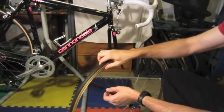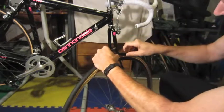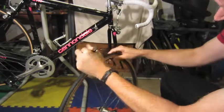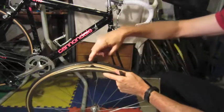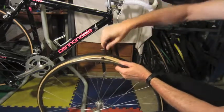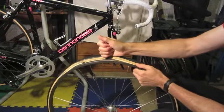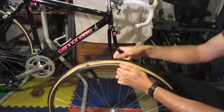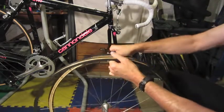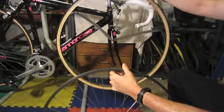We've got one side off, so that's good. I'll unhook this one. Now we have to do the other side — we'll reach under and grab the other side, hook that. Our tool is right there through the other side. We'll take this tool and just hook it along there. The first pull is kind of hard, as you can see, and the tube is getting pinched in there too. I'm not going to keep this tube because it's also 26 years old. Once it gets to a point, you just pop it off like that — and there you have it, the tire is separated from the wheel.